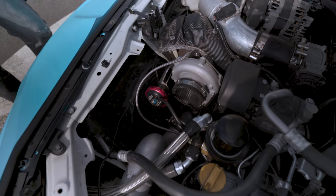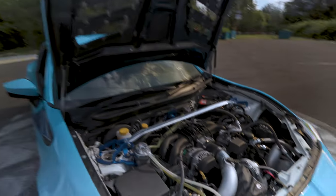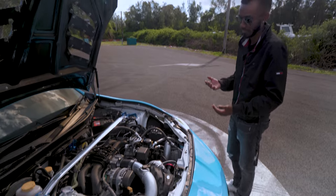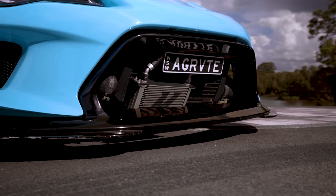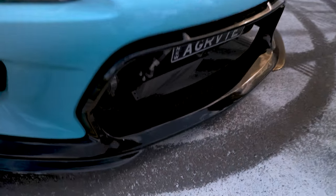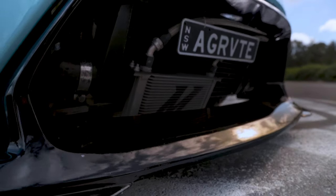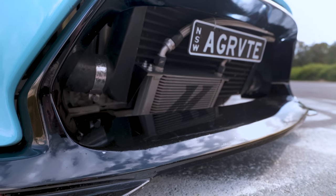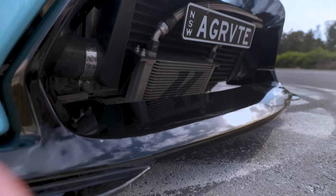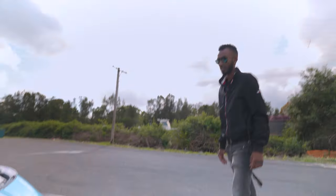The only thing I'm running from SME is the equal length headers. And because I'm also running a turbo and more power, I've opted for an oil cooler at the end with the Mishimoto thermostatic. My intercooler is also a custom intercooler — it doesn't come with any kits — so I've actually had to make my own custom mount for it as well. It sits in front of the intercooler kit with custom bolt-ons, fitting perfectly with the diagonal setting of the intercooler.